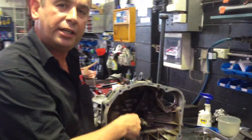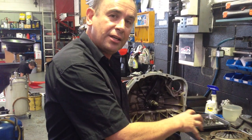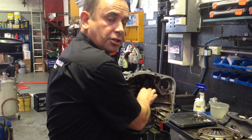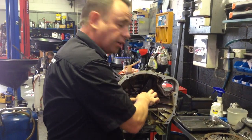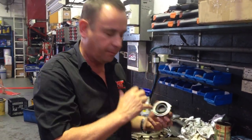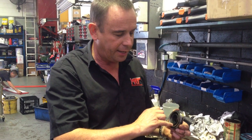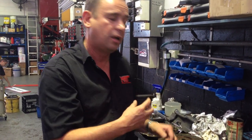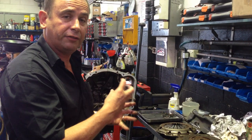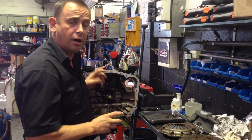We did a similar repair to a clutch and gearbox assembly two weeks ago. It wasn't as bad as this — the release bearing hadn't torn around the driven plate and scoured the nose of the gearbox assembly — but because there was no grease on that slide mechanism, the actual release bearing had worn down the aluminium. Even though on these models it's not cast iron like the earlier models, it's still got a wearing effect on the aluminium part of the housing it slides on, so even if you run out of grease, that mechanism moving in and out every time you press the clutch pedal can wear it down.